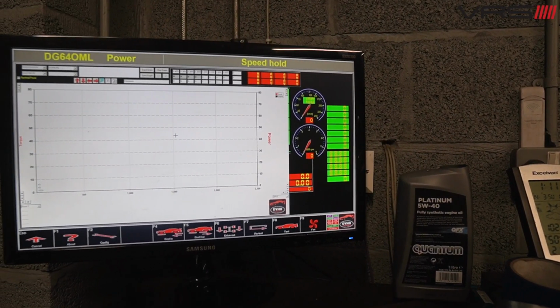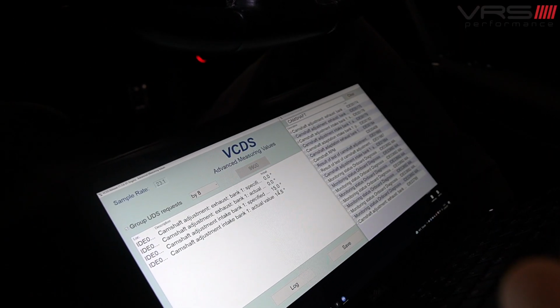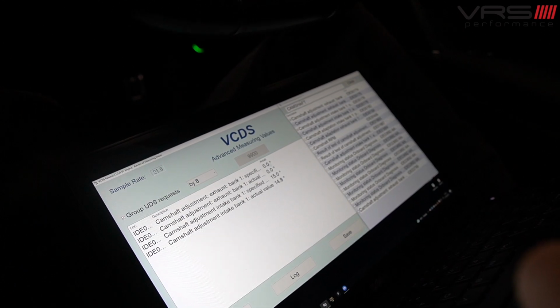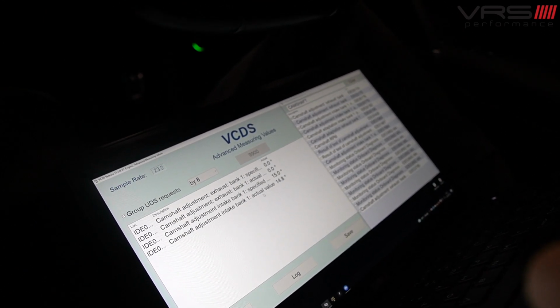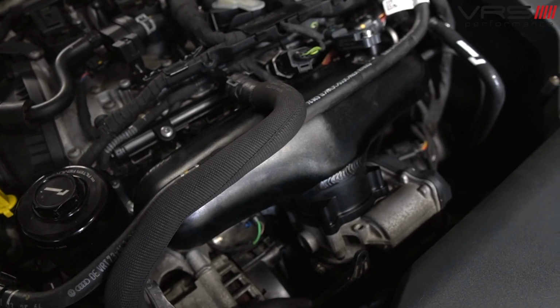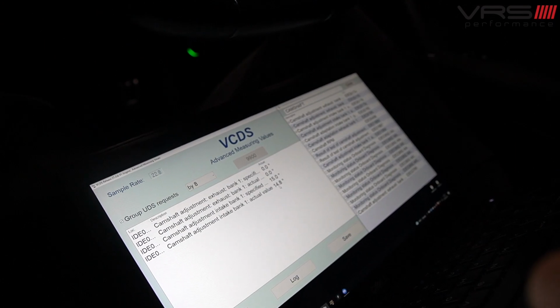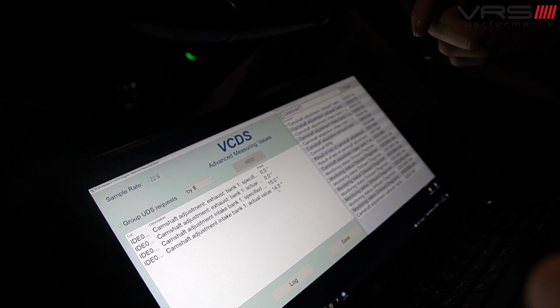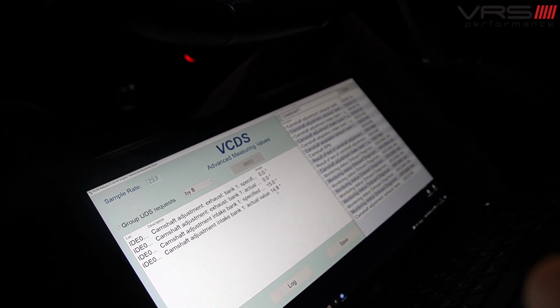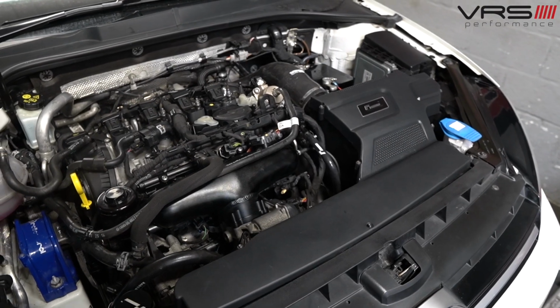So basically the requested angle of the intake cam is the specified angle, so 15 degrees. Obviously the exhaust cam's just sat happy at the minute, but then you've got the actual value as well. Usually if there's an issue, we've had a couple of cars that have had badly worn or potentially damaged magnets and valves, where that 15 degrees is just unobtainable, and they end up misfiring and running lumpy on idle. Whereas this car at the minute, if I rev the car, the values do change.